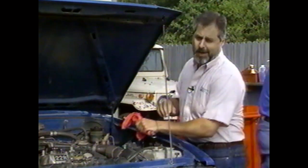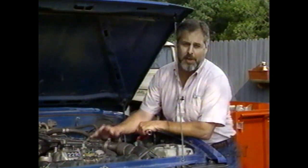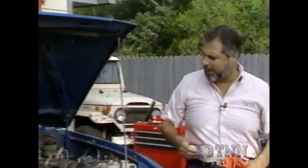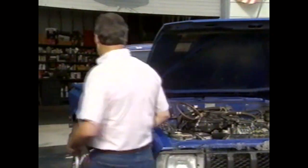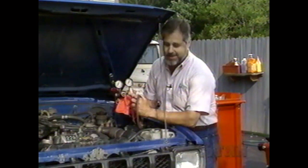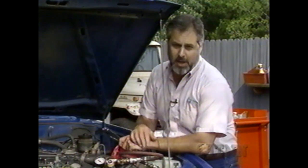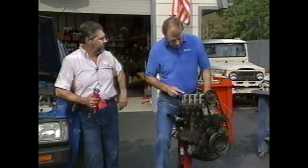The way you know is by doing some diagnostic work. These little engines have a lot of oil circulating throughout them, and you want to seal the oil from the combustion chamber — that's done with the rings and the valve stem oil seals. We've got a 22R four-wheel drive Toyota pickup truck with a lot of miles on it, worked hard. When you drive it hard or start it up in the morning, it smokes out the tailpipe. We're going to use a cylinder leakage gauge, which uses compressed air like a compression tester, to determine whether we have weak rings. If we don't have weak rings, most likely oil is going by the valve stem seal — that's the weakest link in these engines.